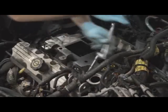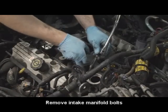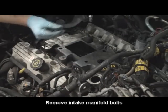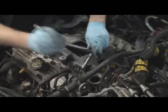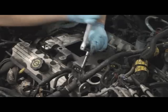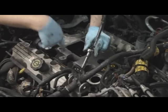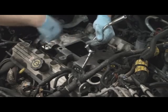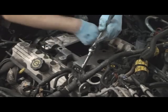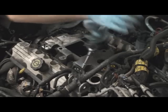Usually you can see signs if you're having gasket issues when you're pulling these things out. Most of these go into oil areas, but the gasket fails right in the middle of the head area, where the two bolt passages are, right here and here. So these bolts here will show signs of sludge on them.